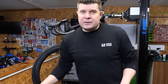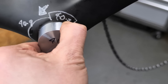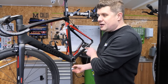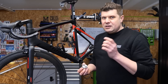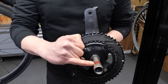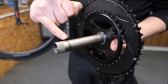Initially I just thought it was undersized. We take our hand bore gauges and a 40.95 goes in just a little bit. There is a taper on this and I've made some markings to help understand what's going on. The drive side is quite similar — actually in fairly good condition, albeit slightly undersized. The next clue is when we look at the crankset. I've put some red pen on here to help with the camera.